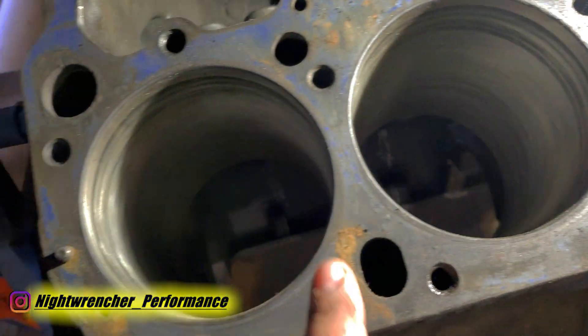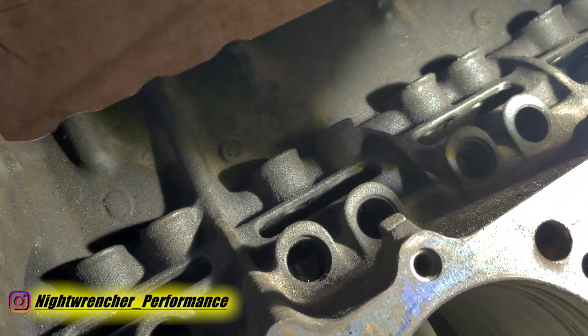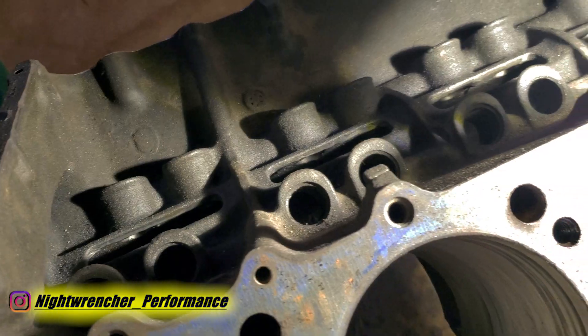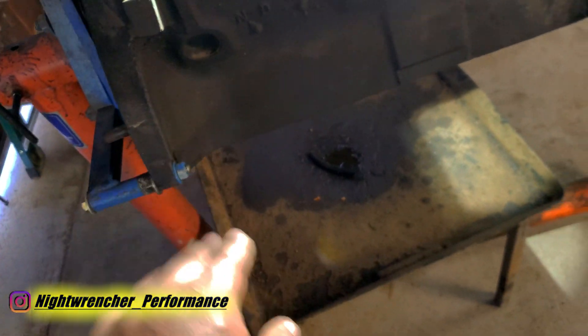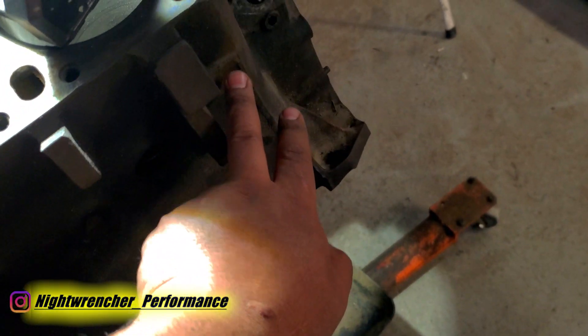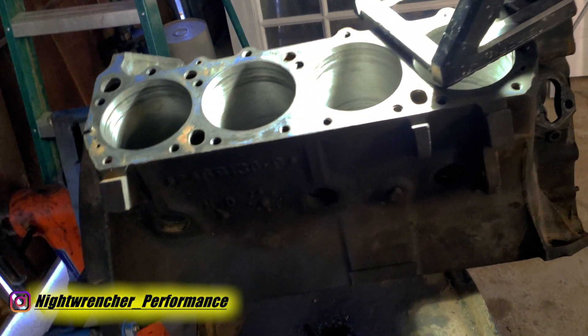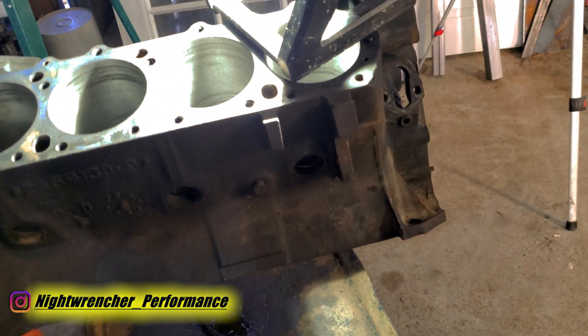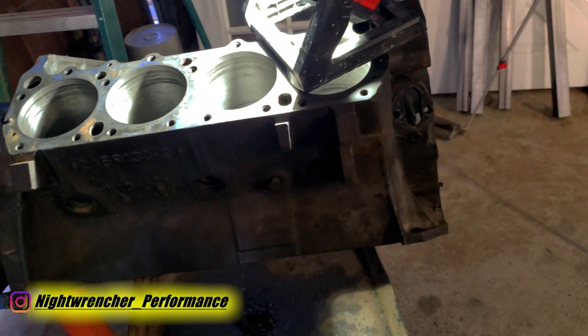Another look at the inside — it's looking pretty good and I'm happy with this. The last thing to do is shave off the outside: here, here, and a lot along this side, then obviously flip it over to the other side. I'm not going to use a die grinder for this — this area is just too large for the die grinder, so we're going to be using a flap wheel and a grinder for this next section.